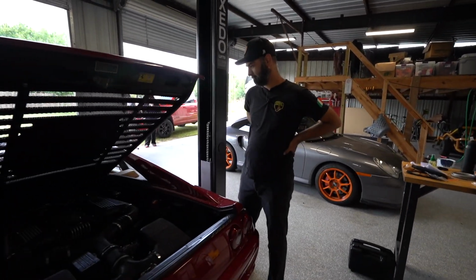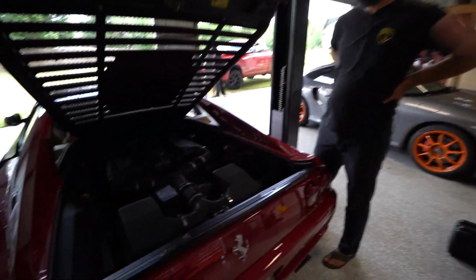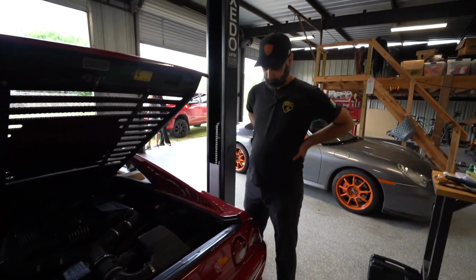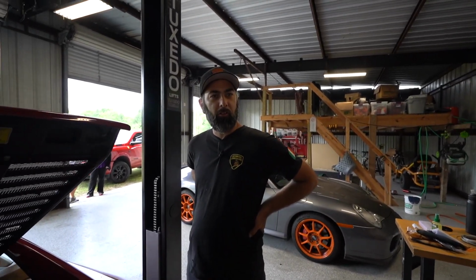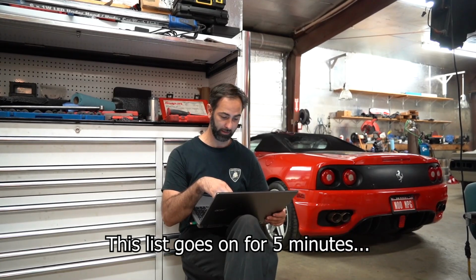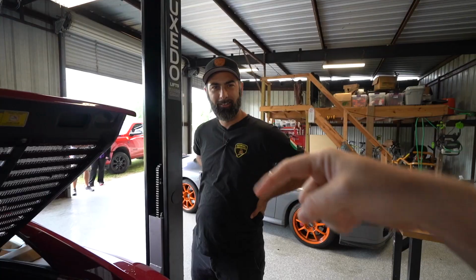So that was one thing that we got into a whole bunch of a tiff with other people on the interwebs. We said, hey, these major services can easily cost $20,000+, even $25,000. We have proof of that. We've seen receipts in excess of $25,000. Insert the video clip where I read off the list of things that you're supposed to do on a 348 while doing a major service. Yeah, right here. Change the engine oil and filter. Check the gearbox oil level. Check the tension of your alternator and AC belts. Check the spark plugs and replace if necessary.